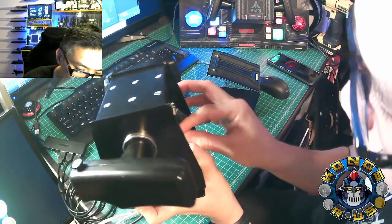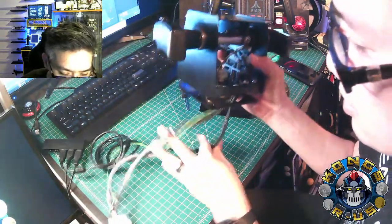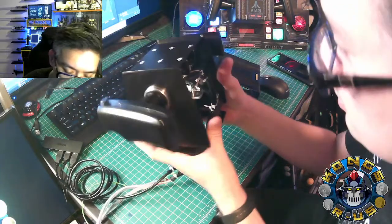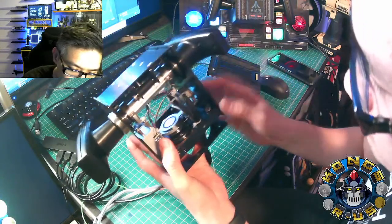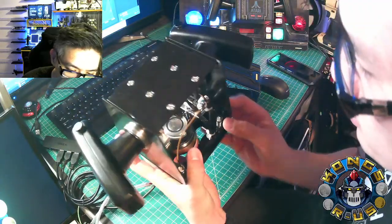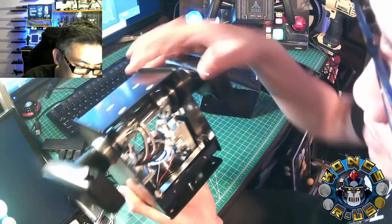And then, yeah, these are all the different input designs that we have here. So you have so many different versions. These are just the extra wires that are coming out. It looks like this smaller one is the input for the USB, and this bigger one here is the input for either the arcade 1-Up or the original arcade. So lots of technology packed into this little guy. That little encoder is pretty much it. That's registering all the buttons, doing all the logic board. So maybe this is going to be a little more difficult than I thought if we were going to try to mod this up or do anything else with it.